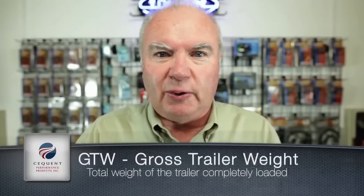There are several considerations when purchasing a weight distribution. First is the GTW of the trailer. Be sure not to exceed the vehicle manufacturer's specification for towing. This information is typically located in a vehicle's owner's manual. Another consideration is the hitch. Be sure it is capable of handling a weight distribution. This information is normally located on the weight rating label of the hitch.